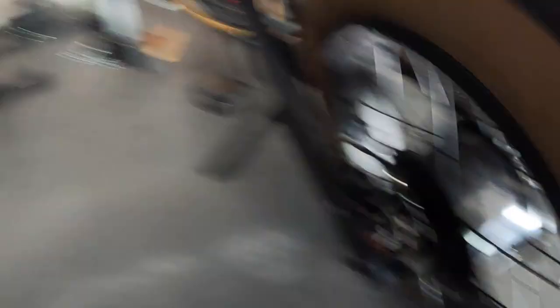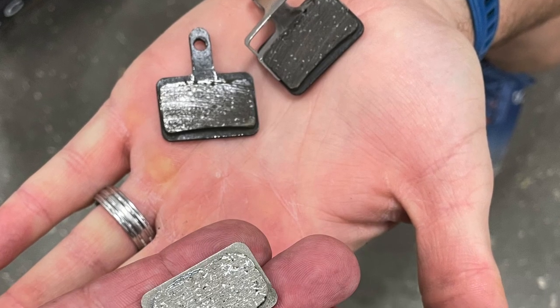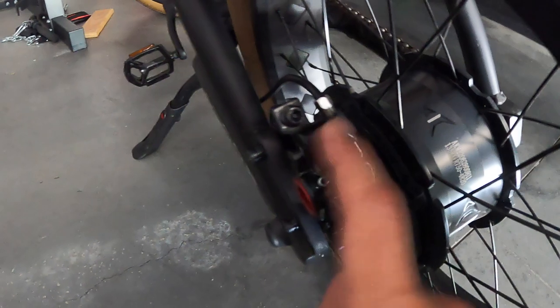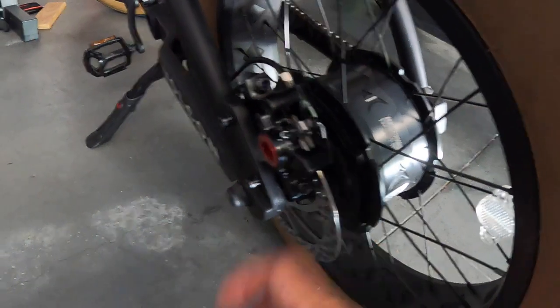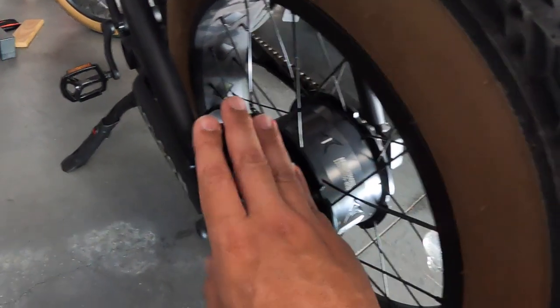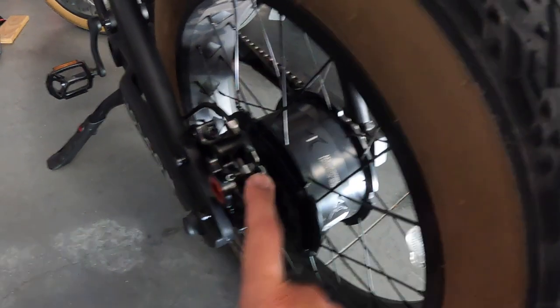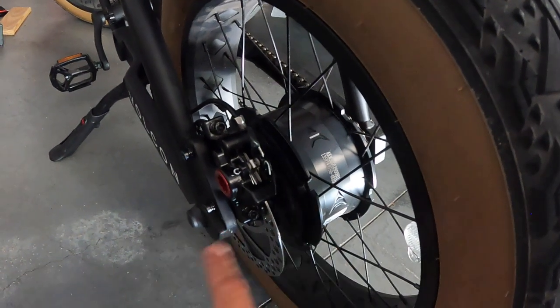I went to a local bike shop and they verified along with me that the pads were contaminated. They also noticed that the fitting looks like it's cross-threaded — they said whoever installed it did so improperly. I contacted Vulcan and put in the warranty paperwork. I also went ahead and bought the brake pads myself because I wanted to ride the bike and didn't want to wait on Vulcan. Part info is in the description below.